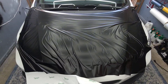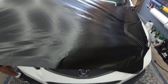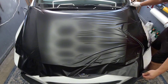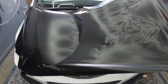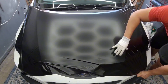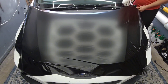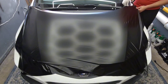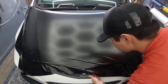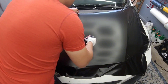If you want to do this at home for yourself or for a friend, you can get that done quickly. As you can see here, you're gonna want to put magnets on the opposite side of what you're stretching so you can get that stretch in the curve section of the vehicle. In the curve section of that hood, this is what you call glassing out — you're gonna want to get that material as flat as you can before you even squeegee it. Here you can see the material already wants to lay flat without even heating it, so that's how you know you got it right.